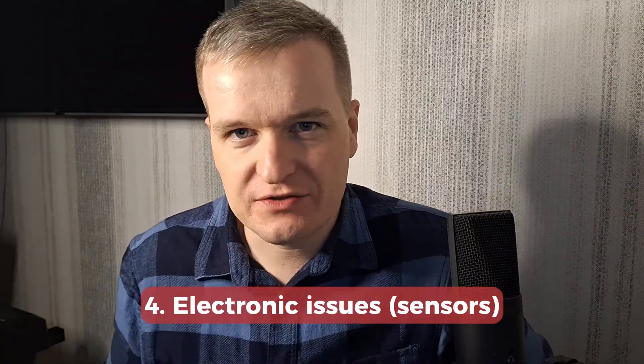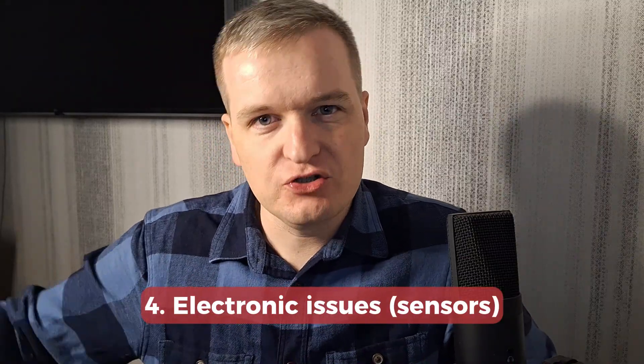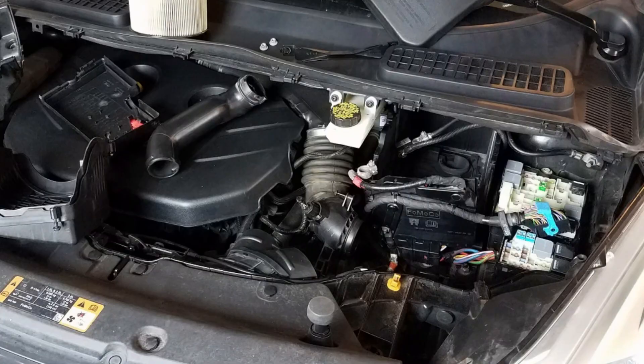Another reason I've seen triggering this error message is a problem with several sensors. There are sensors in the engine and transmission that can throw this message, and they are not always directly connected to the all-wheel drive. The intelligent all-wheel drive system will only work when everything is okay with the ABS sensors, engine sensors, and traction control. There can also be a software glitch, and you can try to fix it by disconnecting the 12-volt battery for several minutes, then reconnecting it so the control modules reset — potentially fixing the problem without any cost.